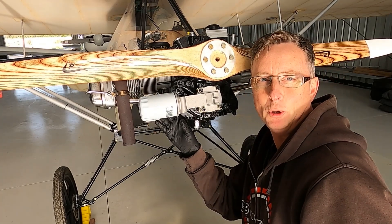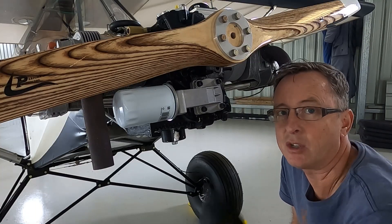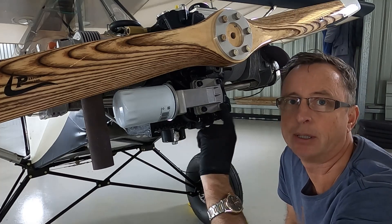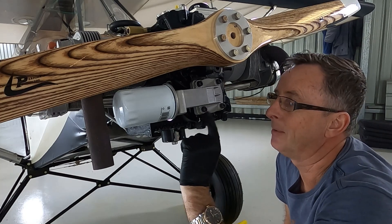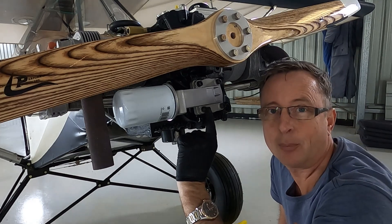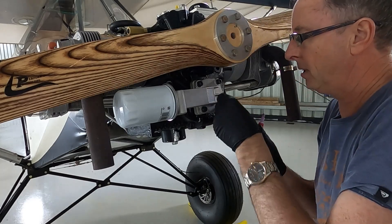You know something — when I got home and was editing this oil pump video together, I realized I hadn't put Loctite on any of the bolts. Also, it's probably a good idea to use a torque wrench: the small case nuts are 15 foot-pounds, large ones are 30 foot-pounds — quite easy to remember on this Volkswagen engine.